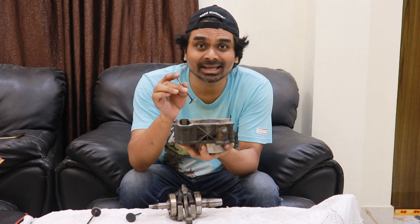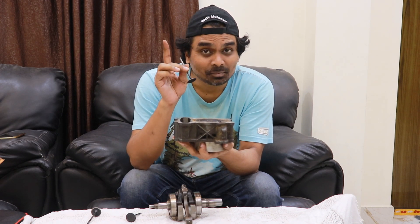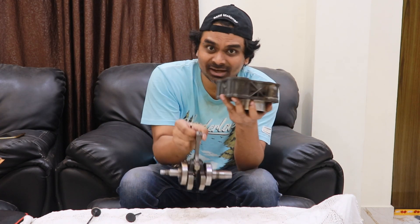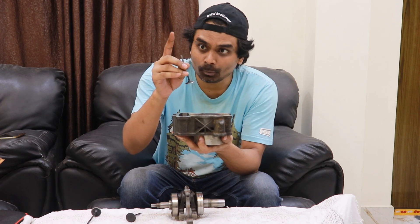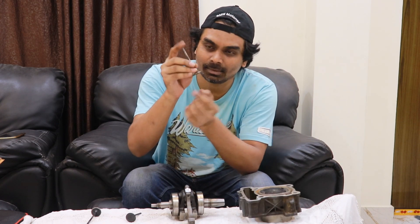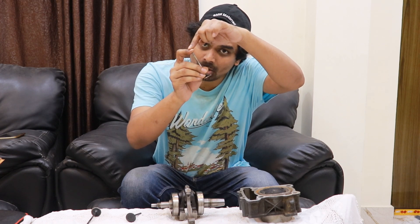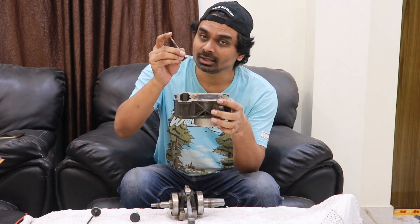The valve gets pushed down by the camshaft — I'll also show how a camshaft looks like in the next videos. In the first stroke, the timing chain moves the camshaft. The crankshaft would be at the bottom of the engine and the camshaft would be on the top. The camshaft pushes the valve down — the general movement of a valve is down and up again. The going-up process happens because of the spring. So in the induction stroke, the intake valve opens up and air and fuel mixture goes in.